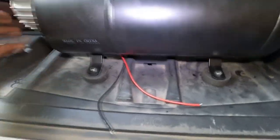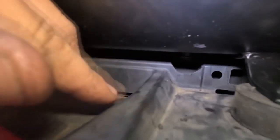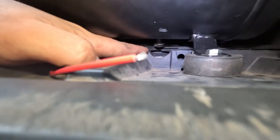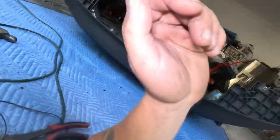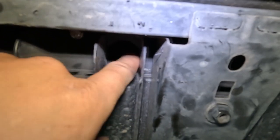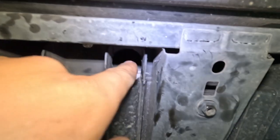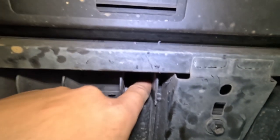The compressor is mounted. I went ahead and used rubber feet on all four corners and the two thin pieces provided in the kit with the compressor. You guys can see I actually made a recessed cut down here for the drain - that's an 11-millimeter - so even with the bumper on, we come up underneath the truck and we can get to it right there. Very accessible, plenty of room. Make sure wherever you mount your compressor, mount it so you can get access to the drain, because this will extend the life of your compressor.